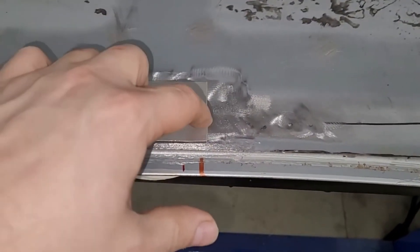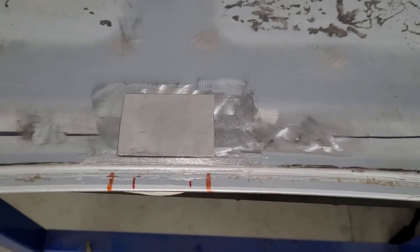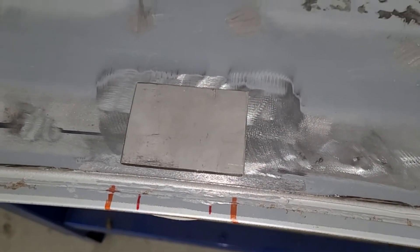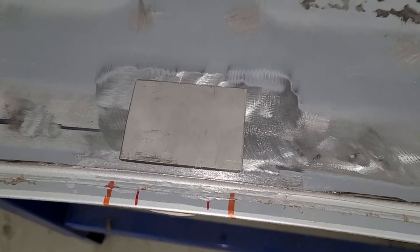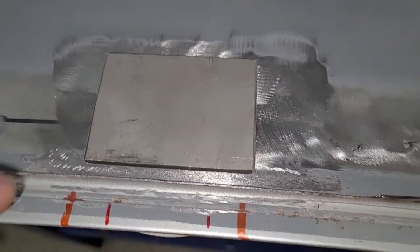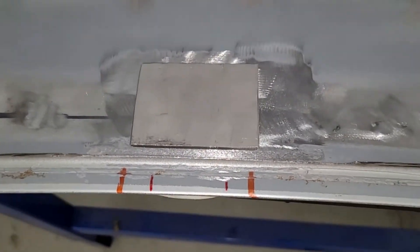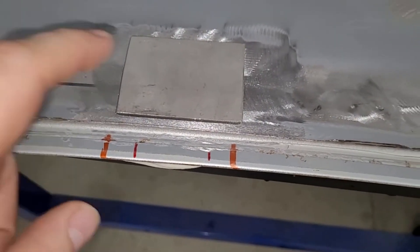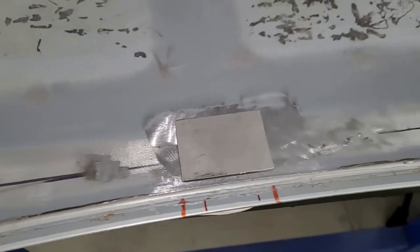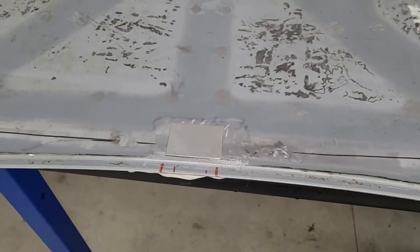The goal is to just tack this down to the sheet metal in a few spots so it doesn't move, and then we can weld a bolt right onto that plate without worrying about screwing the trunk lid up. Metal's clean, got a heat sink under it, we beveled our edges - we're gonna grab our TIG welder and basically just hit it really fast. I might even try fusion welding this - that's the fastest way to do it. Our goal is to get this attached and try not to distort the panel as little as possible.